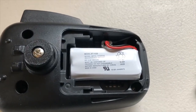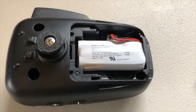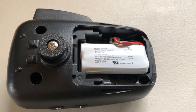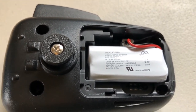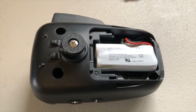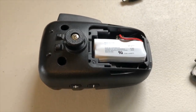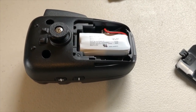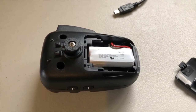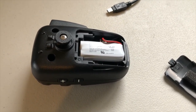I took the battery cover off so you can see the type of battery it uses — a BT1008, which is the same battery Uniden wireless household phones use. It's 2.4 volts and 650 milliamp hours. You can go on Amazon and get a higher capacity 1,000 milliamp battery at 2.4 volts with the same model number, and you could probably increase the 8-hour talk time. My guess is you could get 12 to 14 hours out of it with a higher capacity battery, so if battery life is a concern, you might want to consider that.